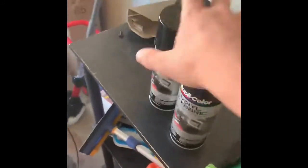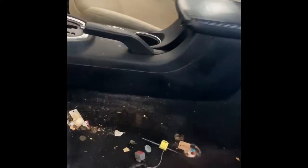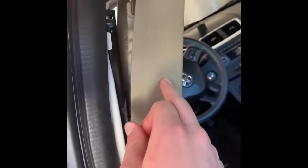I'm gonna show you real quick what I did to get the seat out — it may not be the same on your car. You just take the four seat bolts that hold the seat to the ground, take those out, take off the clips, and I had to take this clip off here to get the seat belt unattached. For an Avenger you'll need a T50 torx bit and a flat head.